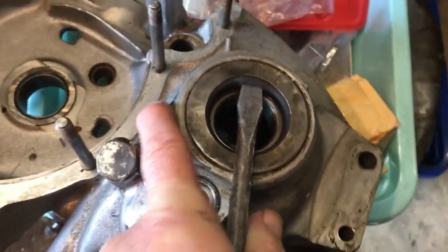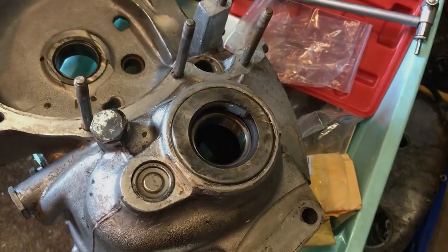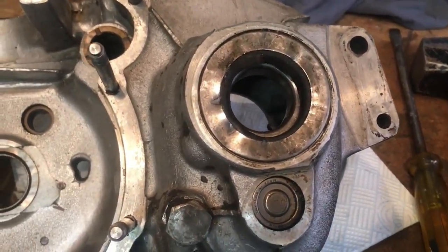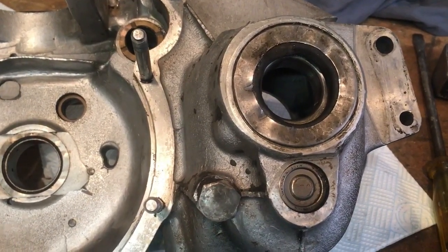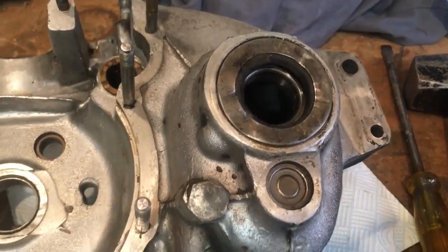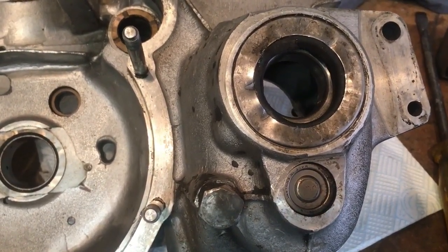The final drive oil seal isn't feeling too bad but the outer ring looks like it's been bashed around. Attempting to tease it out with a screwdriver — can't really do it one-handed, and it's proving a little obstinate. That might explain why it's been bashed previously. This might be another job for the oven, but not today. We'll leave it there and continue with the crankcases in the next episode. I'll do some research on this too — there's not much in the manual about the best way to extract it. I might also take out the final drive bearing behind it and check that for play. Thanks very much for watching, see you in the next episode, cheers!